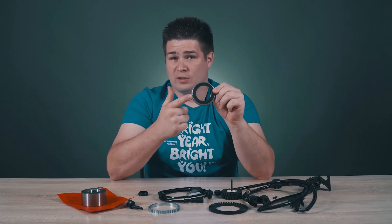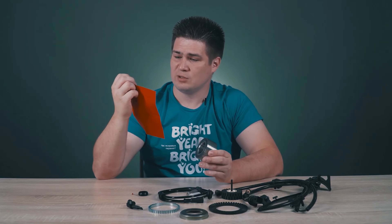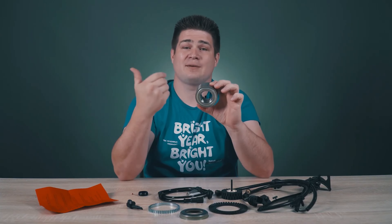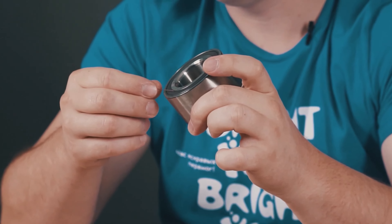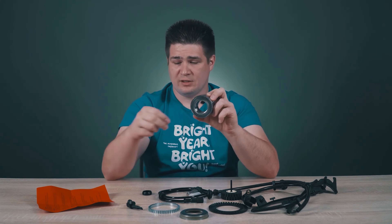Developers now install this magnetic alternating ring directly on the hub bearing. Here I have such a wheel bearing that comes with an instruction written in red in English warning to carefully install the ring with the right side because there is an ABS magnetic sensor. Here is this black ABS ring. There is no ring on the back of this bearing — I can check with a pin: on one side there is no attraction, but on the other side the pin is attracted by the magnet. The bearing rotates with the wheel, this black ring rotates, and ABS sensors installed on the side read the movement of these alternating magnets.